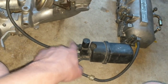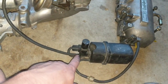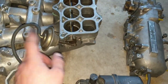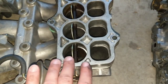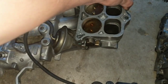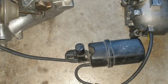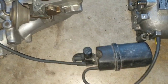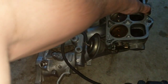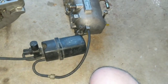Then you have your solenoid, which will be triggered by the ECU to either 12 volt or ground — it doesn't matter, just two pins, so the easiest control possible. This comes as an unaltered vacuum line to the vacuum pot. Currently when the engine is running it's going to be like this because there's vacuum pulling on this. When the solenoid is engaged it stops that vacuum from transferring through, and therefore when this doesn't have vacuum pulling on it to keep it closed, it opens.